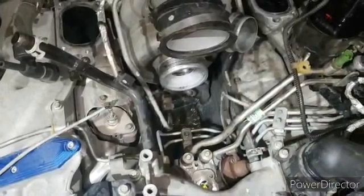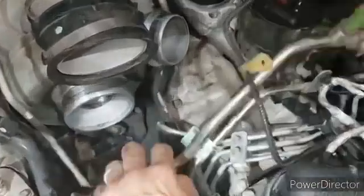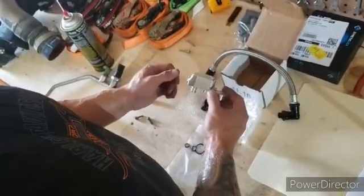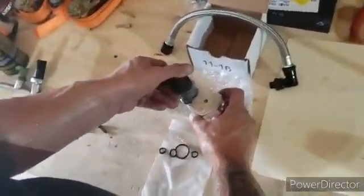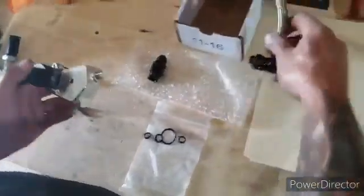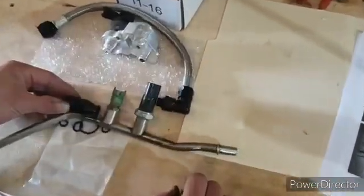Now we've got our fuel delivery valve out. This larger line here is our fuel supply line — the one we're going to modify. The retaining clips are undone, sensors are unplugged. Go ahead and grab the line and work it out. This is our disaster prevention kit for the CP4 fuel pump — I'll put a link in the description. Got it on Amazon for about $220. This kit will relocate our fuel delivery valve, replace the O-rings they supply, and mount it with the factory bolts. This fitting in-line threads in here, and we'll be cutting the fuel supply line and installing a fitting that connects to the end of this hose to reroute our fuel.